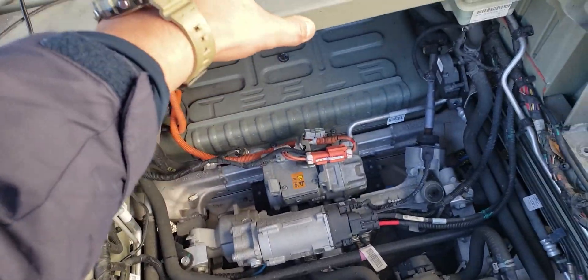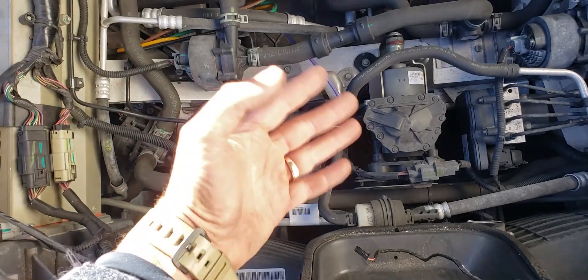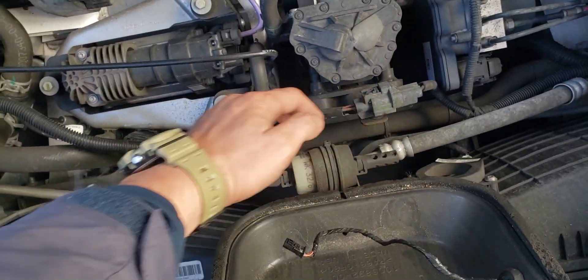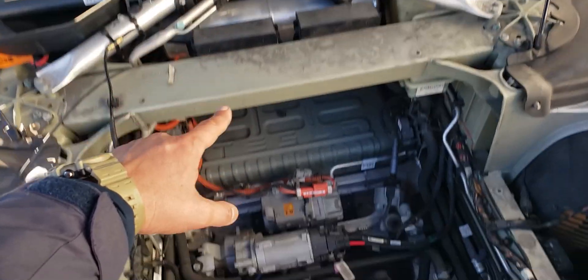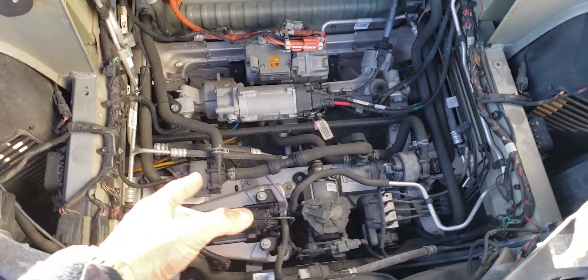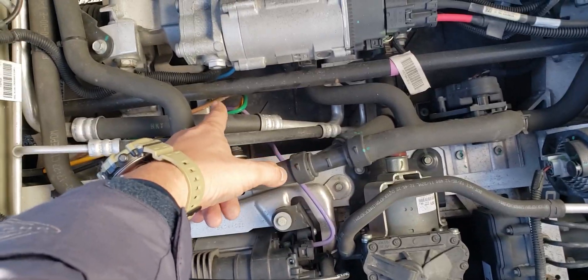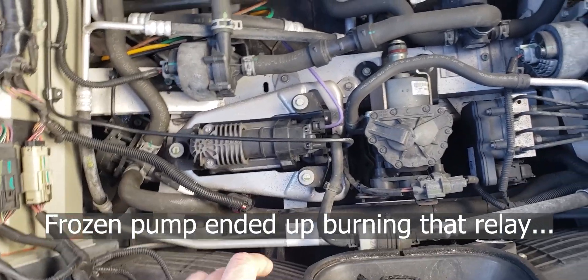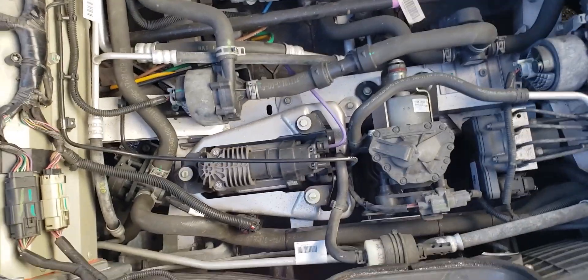The original Tesla manual says this system has to be filled with nitrogen. The pump moves air back and forth into the tank — it's not supposed to take anything from outside because outside air is contaminated. There's a filter here for contaminated air, but when it senses low pressure it has to switch into pumping mode to pump the tank up. In Florida the car was pumping out humid air, humidity accumulated, and water goes to the lowest point — which is right here in that block. I think I had water in there and it froze, which is why the pump couldn't do anything.